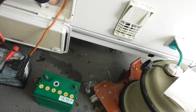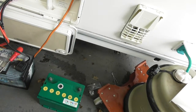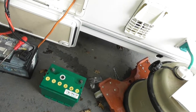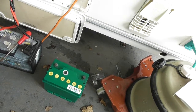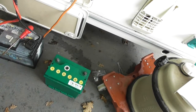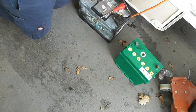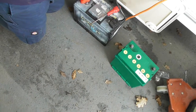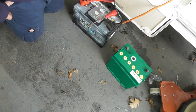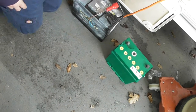Below that we've got the isolator key for your motor mover - I'll give you a demonstration of the motor mover after we finish. I'll fit your brand new leisure battery inside here. Are you happy how the 12-volt system and the 240 system works inside the van? Virtually most of the power comes through your 12-volt battery, and the 240 is recharging the 12-volt as you go along, so you've got a continual cycle of power for the van.